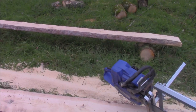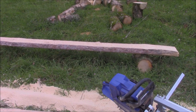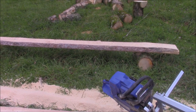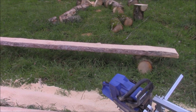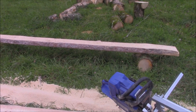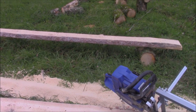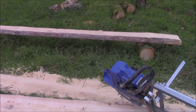So here's the thing. The ability for the saw to cool itself determines how much power you can put into that system. And how long the cuts are matters. So for example, if I've got 5-second, 10-second cuts, I can put a whole lot of heat into the system and not worry about the cooling because, if it's a race saw, they shut it off. Let it cool off naturally. You might get a little bit of blow, but you really don't need much because you're not going to generate heat long enough to stress the system.